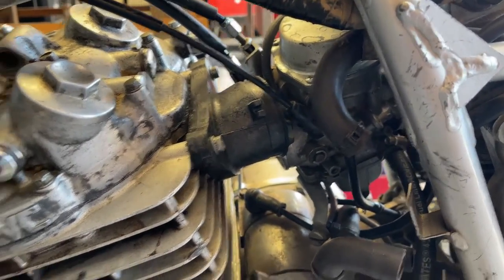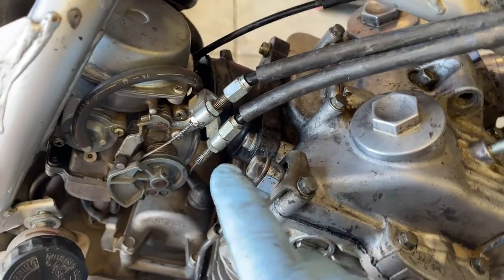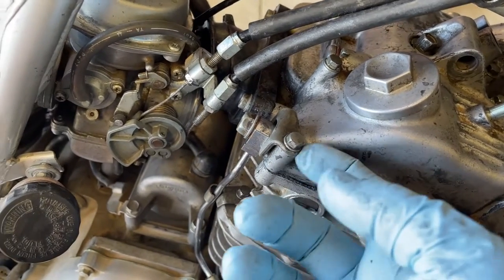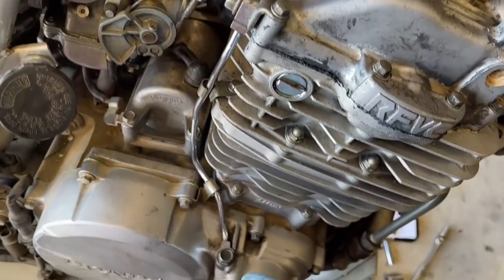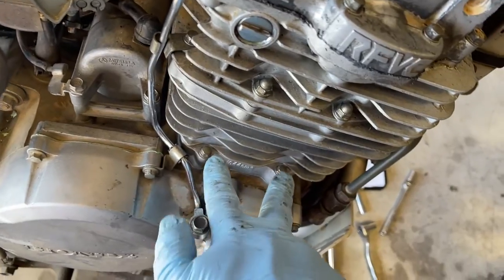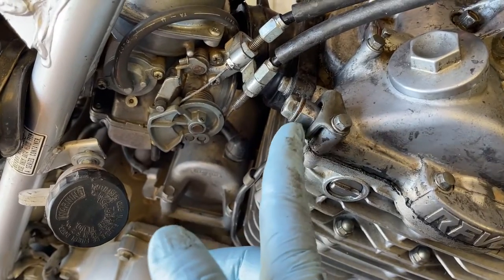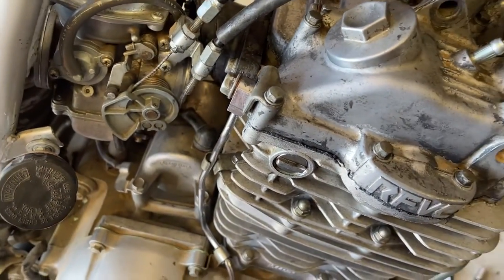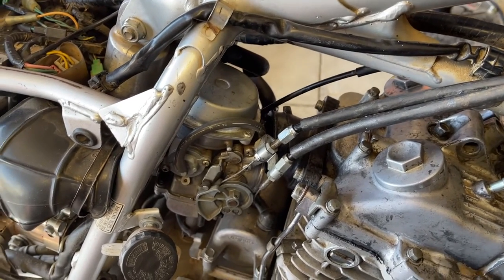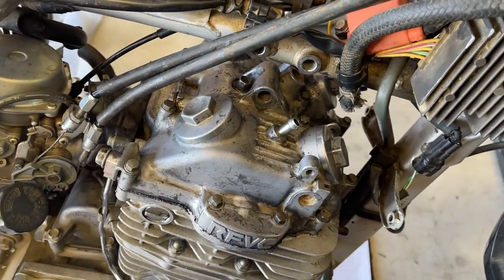I got the intake back on and tightened down. I did some stuff on this side off-camera: I got this oil line and the oil bolt — it's got a hole through the center and a hole at the end of the shank, so that feeds oil down to here or vice versa. There are two bolts I forgot to install that were in the bag of parts, and with them go two copper washers — one underneath the bolt head and one underneath the fitting, just like how it was when I took it off. So all I have to do now is hook the carburetor back up and put the engine mount hanger back on.